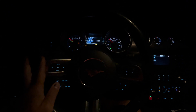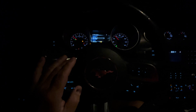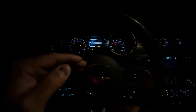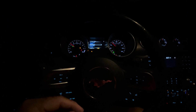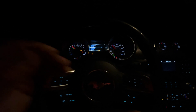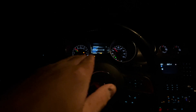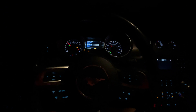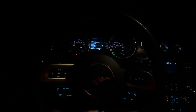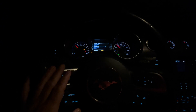The other question we're going to get is: would this be good for turbo cars as an anti-lag? No. Turbo cars need some kind of spark cut to get the turbos to light up while you're holding some kind of speed - that's when you get the popping and pinging. When you let go of whatever button is activating that two-step, that would be good anti-lag. This would not be a good anti-lag situation - all it does is hold the revs. It does not institute a spark cut, it does not spool up the turbos when you're floored. It wouldn't be the same effect as brake boosting it.